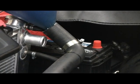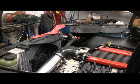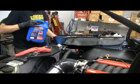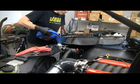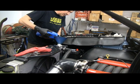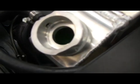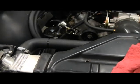The next step is to fill the radiator itself, which will fill up the engine from the bottom — filling the radiator also fills the bottom of the block. The radiator is for the most part full, and I put a little bit into the overflow bottle. All told it took about four to five gallons.